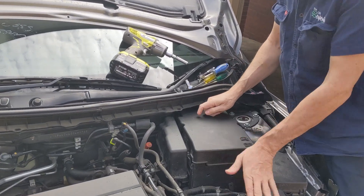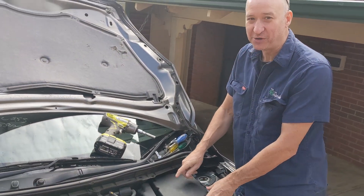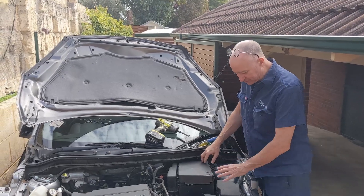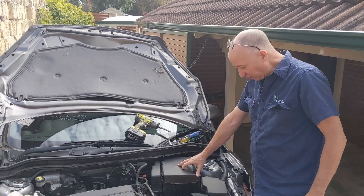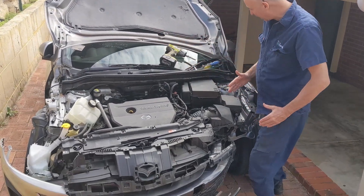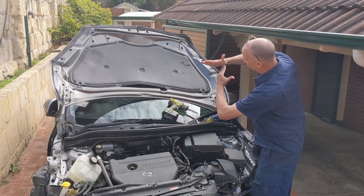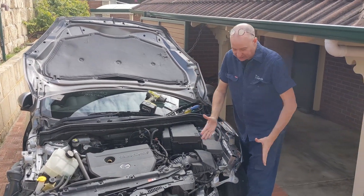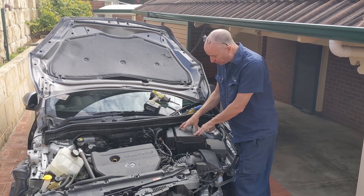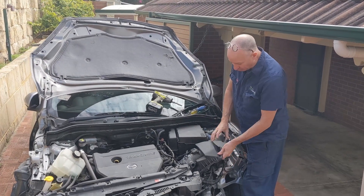The gears get really hard to shift — it'll take a long time to drop into drive or reverse and it just won't drive particularly well. People say to me 'my transmission is broken,' but most of the time, almost always, it's not the transmission, it's the transmission control module. The TCM lives under the battery box, so the first thing we need to do is remove the battery box.